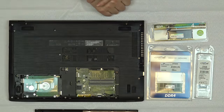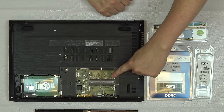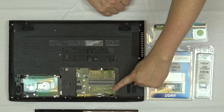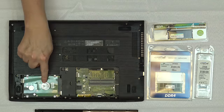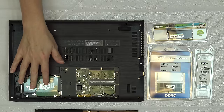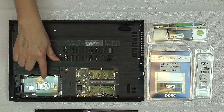There are really only three things in here to look at. The first is our RAM slots — this is the existing four gigabytes of system RAM provided with the computer, and there is an empty slot we're going to install more RAM into. This is the one terabyte hard drive that has all of your data on it — Windows, your files, your programs, your data. All that is on the one terabyte two and a half inch hard drive right here.